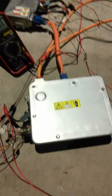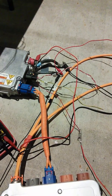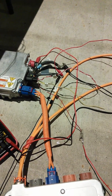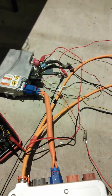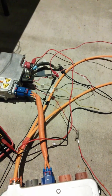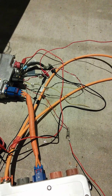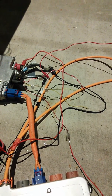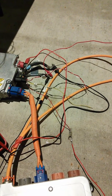The only thing I had to do on the DC to DC converter: it has a CAN output which I'm currently not reading or paying attention to - I'm guessing it's going to put out some conversion data, temperatures or something. It's normally water cooled but that's not hooked up right now. There was an enable line - I gave it 5 volts first and it didn't do anything, then gave it 12 volts and it came alive. There's also an HVIL in and HVIL out which are currently not connected.